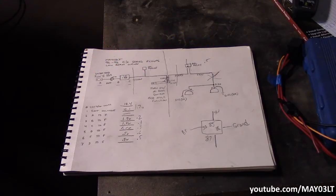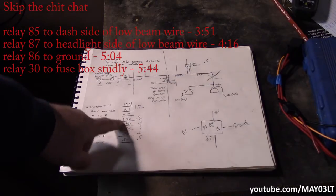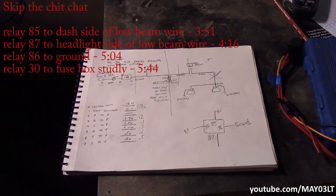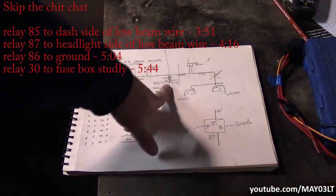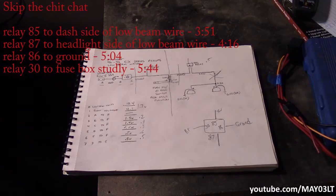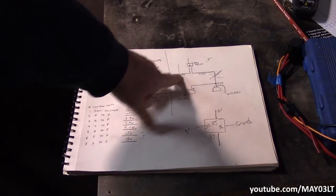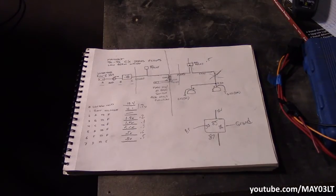Hey, what's happening? In the last video for this 98 Chevy pickup, we went through and did some voltage drop tests. Quick recap: there was voltage drop through the high-low switch. The switch itself is $150 to $200, so not replacing it. Not only was this switch at fault, but there was another half-volt drop through the rest of the circuit, so I decided I'm not messing with that.